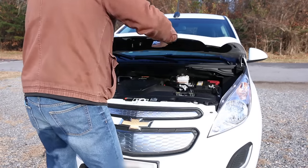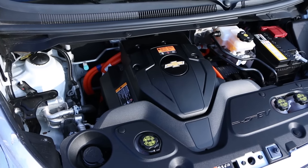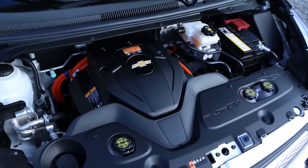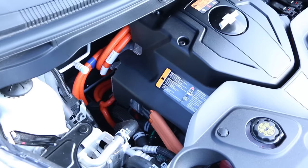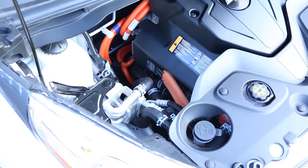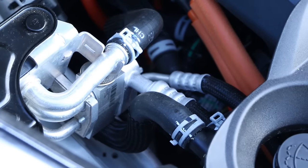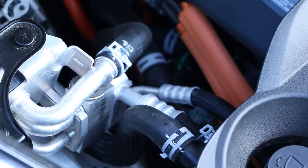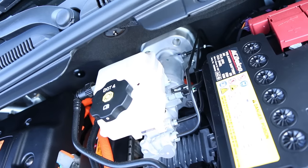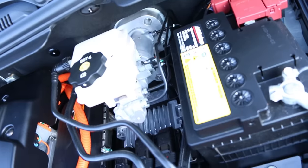Let's step outside and pop the hood. There's not a whole lot to talk about — they try to make it look like an engine, sort of like a forward-facing V4. You can see very large tubes for the AC system, which also cools the battery — awesome. The brakes don't have a vacuum booster; they have hydraulic-boosted brakes.